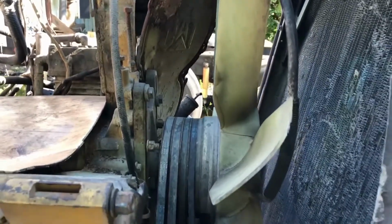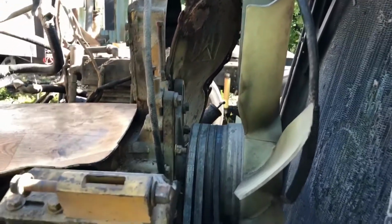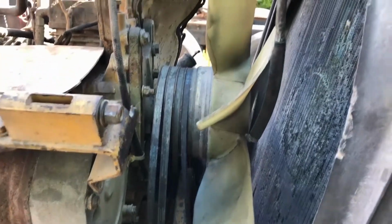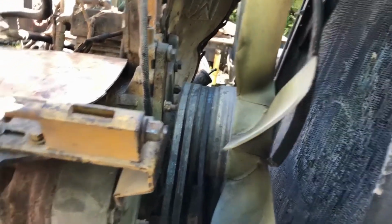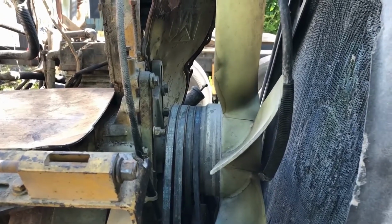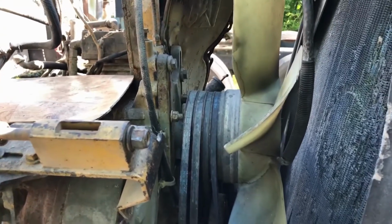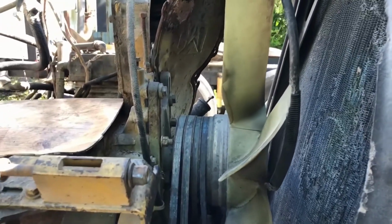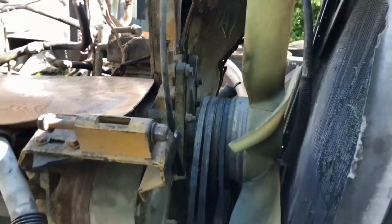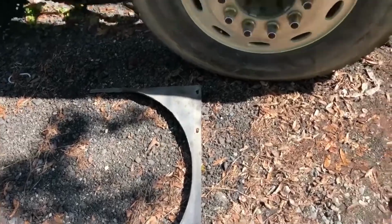Mr. Morrison, I think, is going to come over with maybe one of his wreckers or something, and that looks pretty heavy. So maybe he can lift it out of there for me once I get it off of there. So we'll see. But first up, get those 4 bolts broke loose, get tension off the belts, take the belts off, and go from there. To make things a little bit easier, I'll remove what's left of this fan shroud. Try and make some room to try and get this drive off of here.